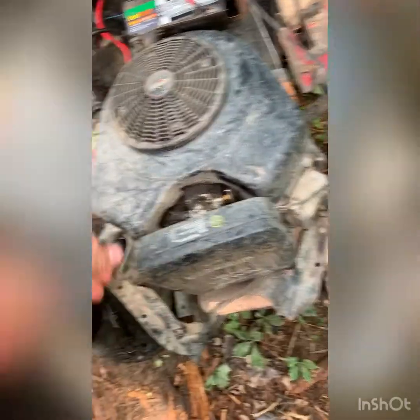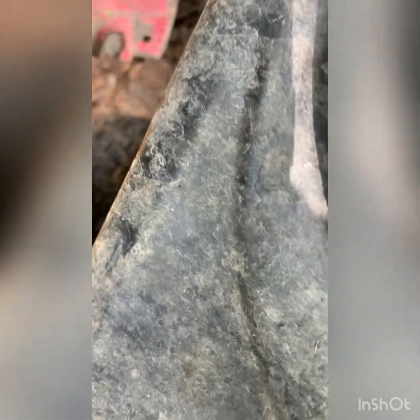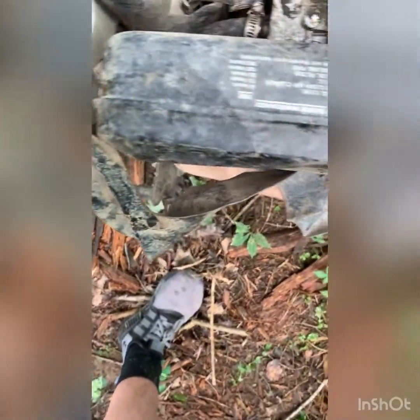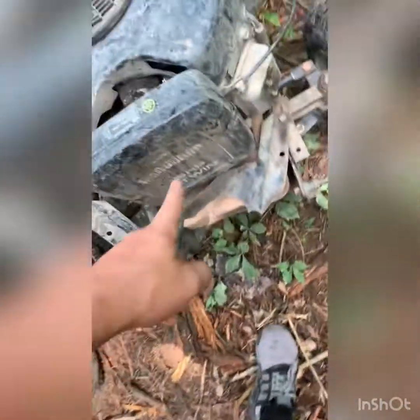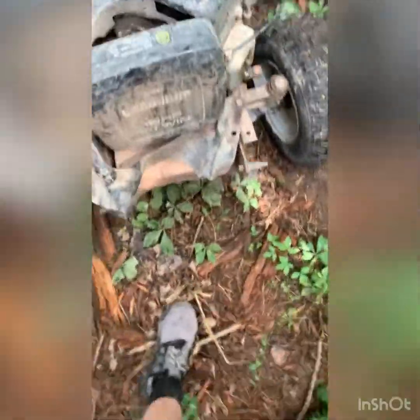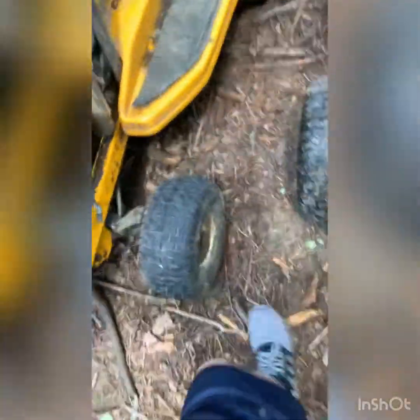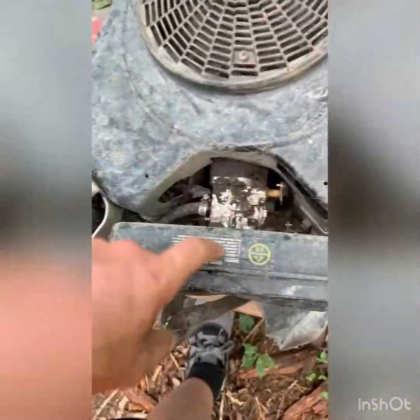This motor's doing good. I had the carburetor half under water — watery oil, like always. She didn't cut off under water, but she was definitely taking in water because the bowl was under water, and the rest was just splashing up so it was sucking. It's not going to suck in from back there but it's going to suck in through the air filter, so it had to have sucked it in. The water line was up to here, and the air filter was soaked — right at the top of the carburetor.